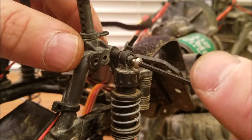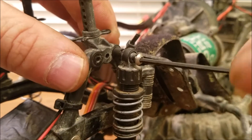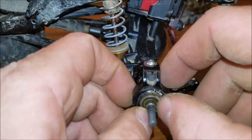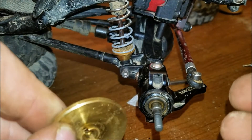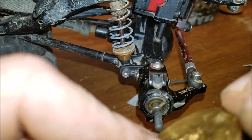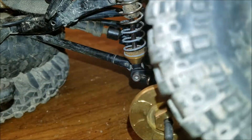Maybe I'll just watch it again if I have a question on taking an axle out or putting it in — I've pretty much done it all in this video. Go ahead and get ready to put our beef patty back on — push our bearing all the way in. Here's that beef patty and the pin I've been talking about. Slide this pin in, kind of try and center it up, take the beef patty, line it up, adjust it, and it's locked in. You'll see on the back of the wheel how it sets just in there.